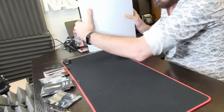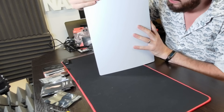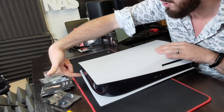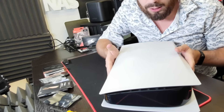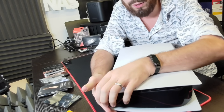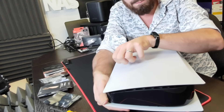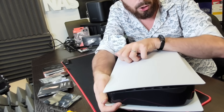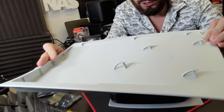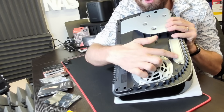Get your PlayStation and place it with the PlayStation logo faced down. Make sure your hand is where that logo is so you know that's going to be the furthest away from you. Place it down like so. Then place your left hand on top of the corner that isn't the PlayStation logo corner, and place your other hand underneath. You need to raise it ever so slightly and pull back — this hand is just here to secure the rest of the console. Lift it up, pull it back, and the lid comes off. It's not screwed in; hooks keep the system in place.